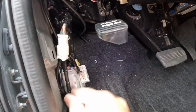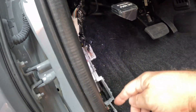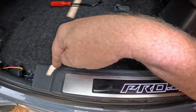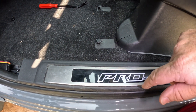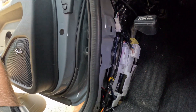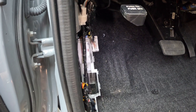When I dug into mine, I found it already had a plug in here. If you have the light-up panels in your Pro4X, that's why — it's a dealer aftermarket installation that already has the pigtail. That's a tip I learned from a viewer, so appreciate that. Basically, just plug your wire in, run whatever accessory wires you want to it, hook it all up, and you'll be all set. That's it for now — thanks for watching.